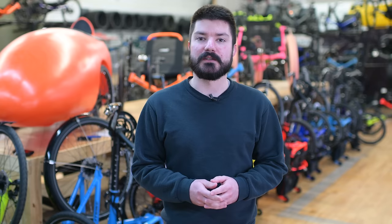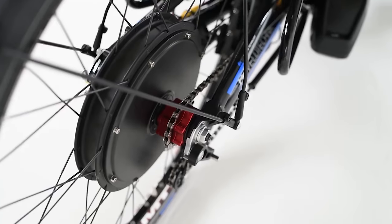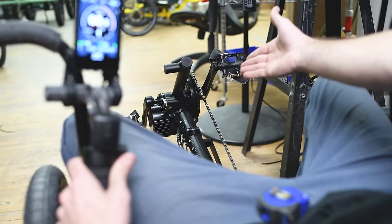We have one more tip for you to make your trike go faster. This tip is kind of cheating, but if you want to be able to average 20 miles per hour or even faster, there's no easier way to do that than by adding a motor to your trike. This is probably the only way to get those speeds if you've got a heavier trike and like having thorn-proof tires. Fortunately, with today's motor options, you can choose how much the motor helps you — i.e., pedal assist — so you choose how much of that workout you want. Depending on where you're located and what type of riding you want to do, there may be more or less options available to you. Direct from the manufacturer options typically do not have a throttle and may be a lower power to fit within the widest legal limits. Systems like the Shimano Steps and Bosch Active Line have excellent torque sensors that add assist naturally as you pedal. Other motor systems such as our Bafang boom mounted motor kits and our 1000 watt hub motor have multiple levels of pedal assist that are cadence based, as well as throttles that you can use at any time even without pedaling.